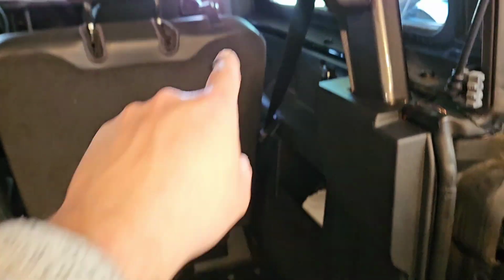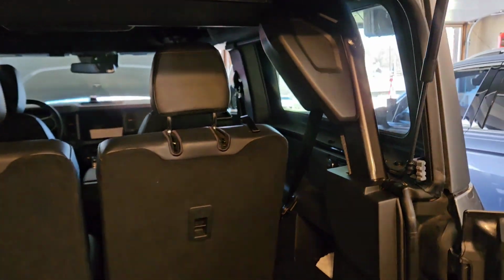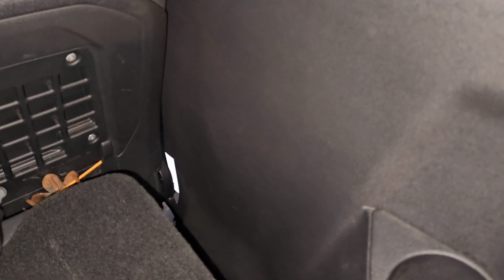Then you need to lay your seat down up there, okay? In the Bronco. I'm gonna get a little closer so you guys can see. Okay, in the Bronco, once you let your seat down, the wire that you were looking for is in here. You can almost see in there, down there near that pillar, okay? Your white and orange wire is, okay? What I did was stick a splice down there, reach my arm down there, and splice power, you know, splice another wire coming out the back here, which I'm getting ready to show you. But that is the wire you need to be able to use your aux switches to power,